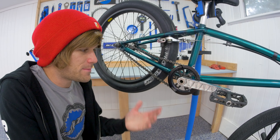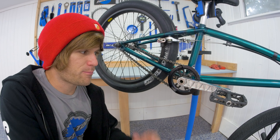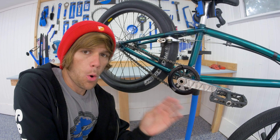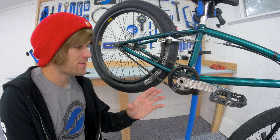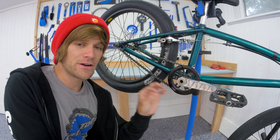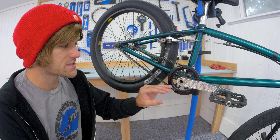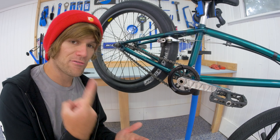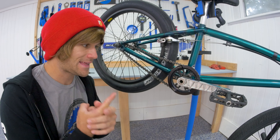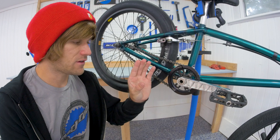You could perceive it as a problem for being proprietary, but I think it's just part of the experience of buying this small batch, USA-made crank set. The other proprietary thing is that it has a proprietary 24 millimeter bottom bracket, because it is not the exact same size as what BMX calls 24 millimeter. So basically when you buy these cranks, you have to buy the bottom bracket and kit, and then some sort of adapter or sprocket to go with them.